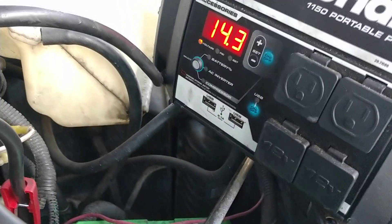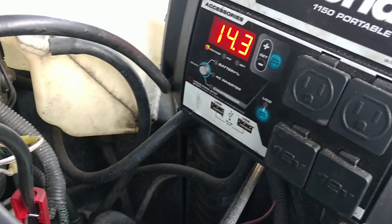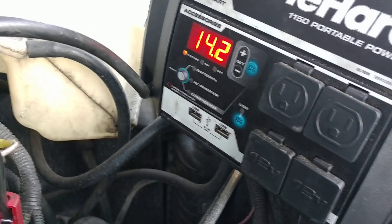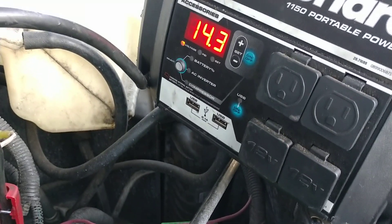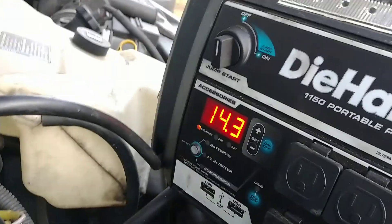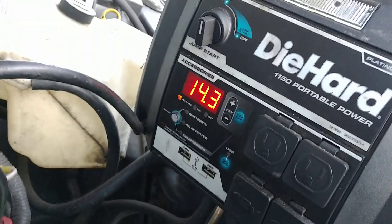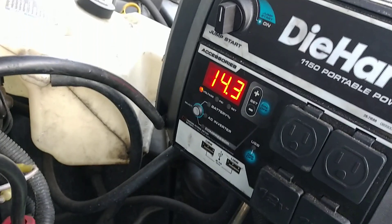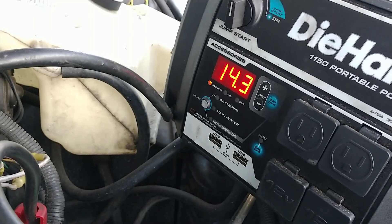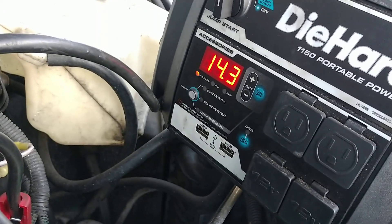It's one that you can use if you start it daily, use it daily, constantly charge it, and you're not using any power — no chargers plugged in for your phones and stuff like that. Day to day you can get by with it and it sounds like it's working okay, but then all of a sudden it's just not going to work. There's going to be a night where it was too cold or you were sitting in a parking lot with your foot on the brake too long and it's just not going to start. Anyway, that's how I test batteries using a voltmeter — it works every time, it's very accurate. If you're having questions about your battery and sometimes it doesn't start, if you put a voltmeter on it and it drops below 10.5, I would get ready to replace that battery as soon as you can.